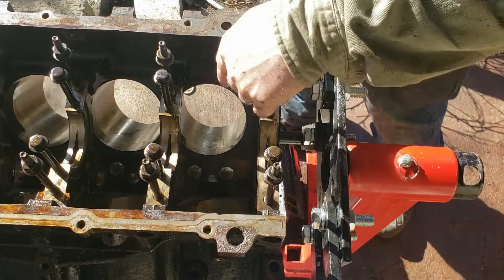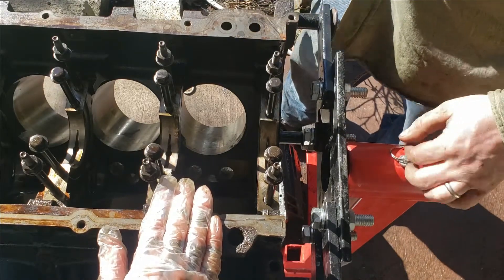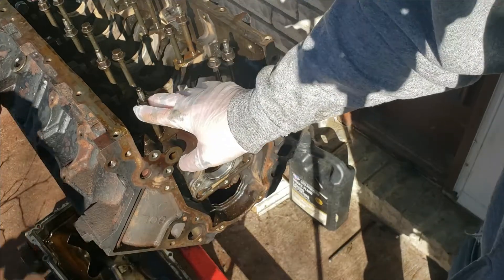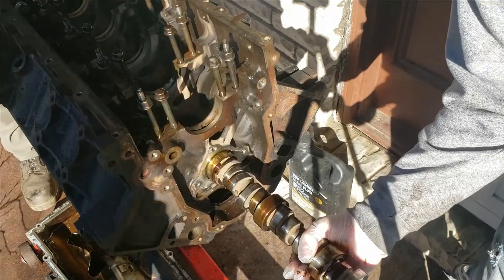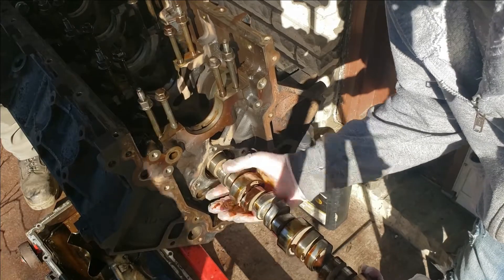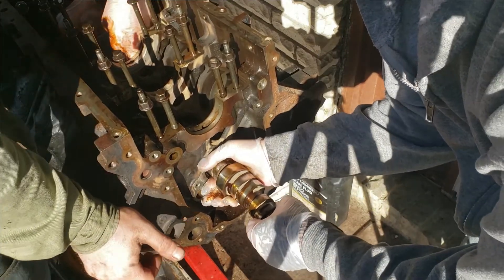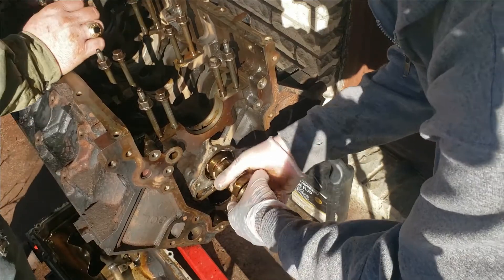Oops — a piece fell into the pan, we'll get that off in a second. We'll flip the motor around. The next step is to lube your new bearings up good and test-fit your cam — your new cam or your old cam. We just went ahead and put oil on it and we're going to feed it in and make sure all the bearings spin good. We've checked the front three and know they're good, so let's go ahead and feed these on in.